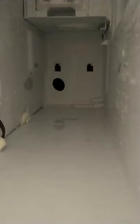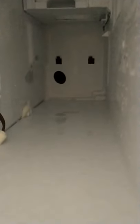Back there. I don't know if you can see that hole. I'm trying to point up to it. That hole right there, up there, is usually clogged up with ice. So just reach back there, clean that ice out. That hole back in the back, the one at the bottom left, the black circle hole, I run my steamer down that hole. That's the drain hole. Just make sure the water's draining out there. Run that steamer down there for a good little bit. Get all your ice up in here and dry this whole container up with your napkin.